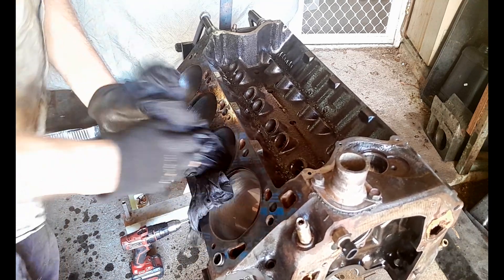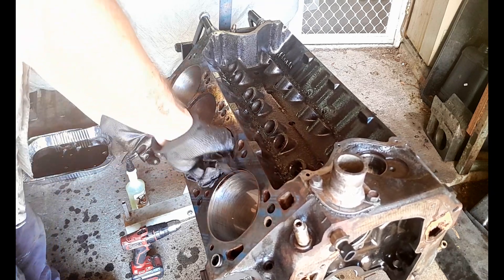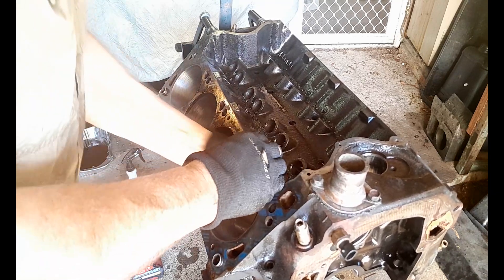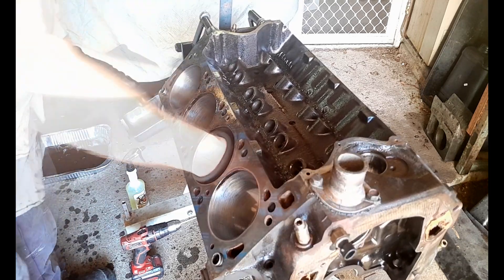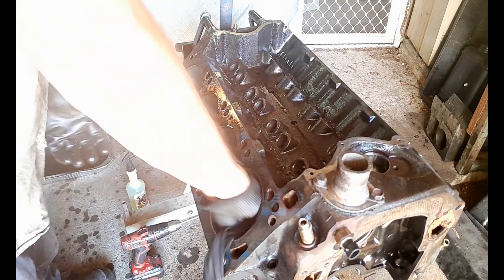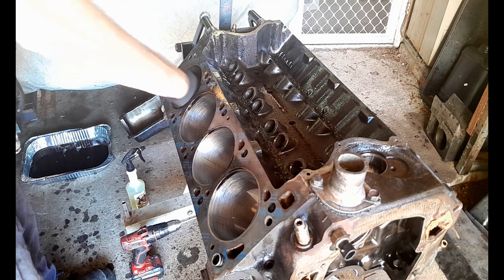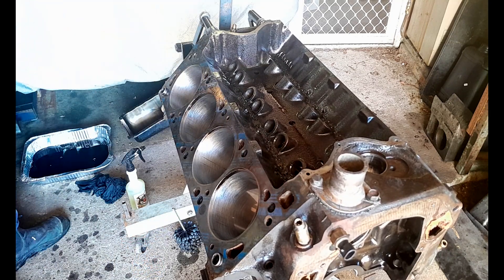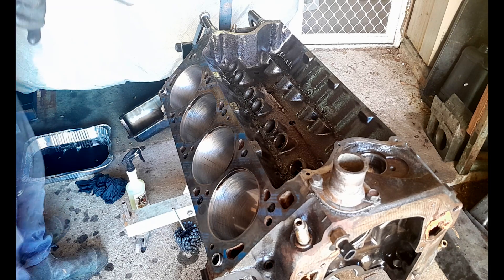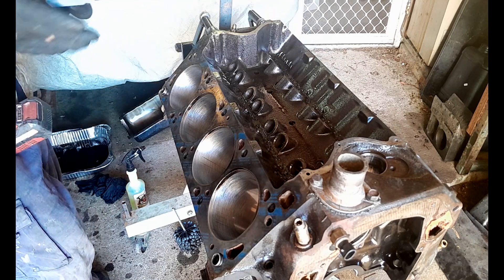I'm really trying to pull out all the stops here to try and get a success story without having these cylinders machined and re-bored, and I know it's a big ask. After I've done this I'll have to check all my piston gap again — shouldn't be too different but I will have removed some material. I'll say goodbye to the ball hone and hello to the spring stone hone, putting some tension on these stones so they're really biting.